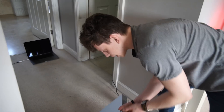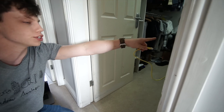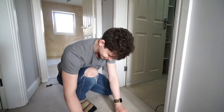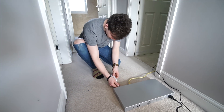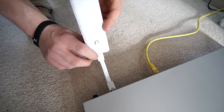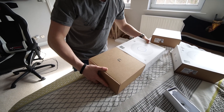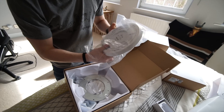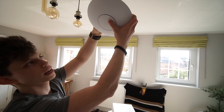We're going to give power to our switch and then give our switch internet access via the cable from the USG. We're just going to plug this into port one. I'm then going to plug in our Ubiquiti Cloud Key which is going to tie everything together on this install. Now we've got our three wireless access points, so we need to get these out of the box. They're absolutely massive but they are just the best wireless you're going to get — these are incredible.